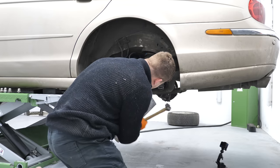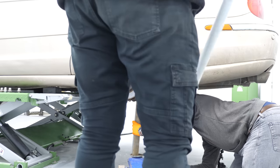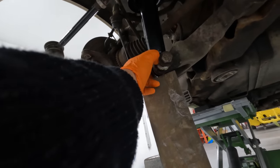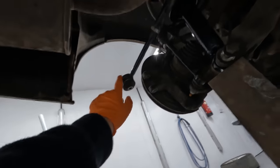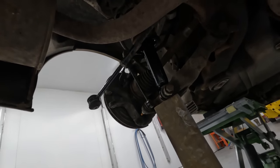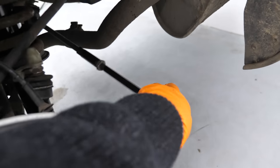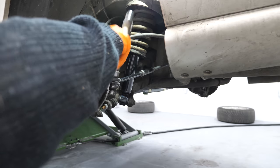Once the shock was secured at the top mount end I needed to line up the holes at the bottom — this bit was fun as I just got to hit things with a hammer. We got a jack underneath to support the bottom of the shock, then some more hammering. We've raised the shock up into place between the holes, bolt through, secured it, and then tightened it up at the top as well. Surprisingly more straightforward than expected. Finally I needed to re-secure the tie rod in place, which involved manhandling the brake assembly and — guess what — more hammering.